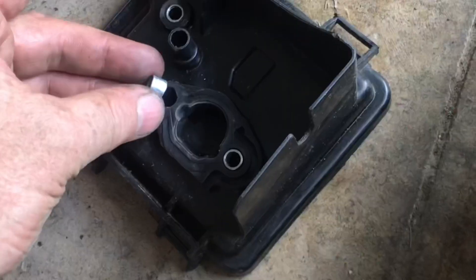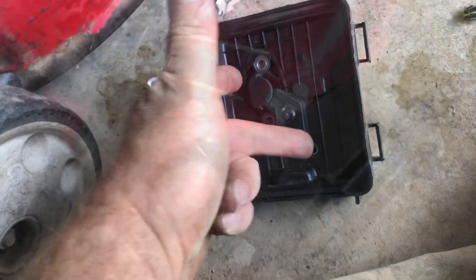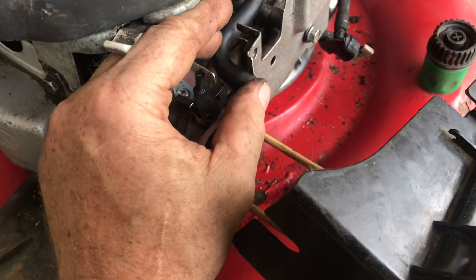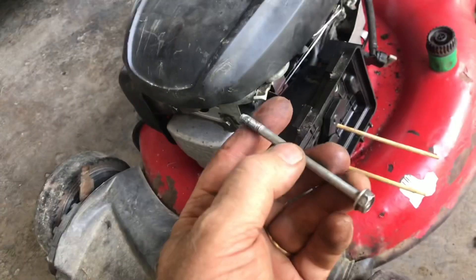The air box gasket goes in place. Make sure the air holes are all the same way. Make sure the shims didn't fall out of the air box — there are three of them on there. Without fighting anything, we can put the air box back. Without too much fighting, we'll put the tube in place. Breather tube is in place. We'll have our bolt ready.